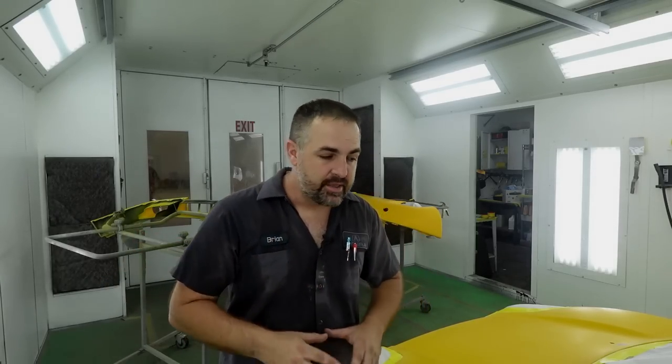And this is not only a blend job, but we are fixing those hood chips and different scratches along the area. So we're freshening it up. And really, we do have enough area for blends, so it is good that we can keep it contained. So don't go spraying all the front end if you can't get a color to match.